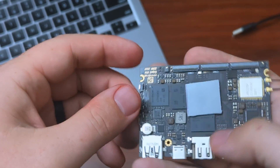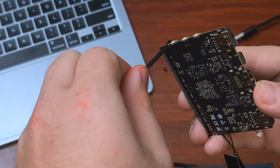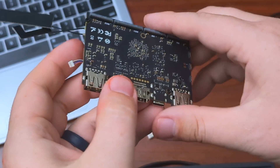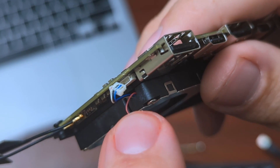It's been a couple of hours and I've been playing around with this thing. The fan installation is pretty easy: get the thermal pad that's included, stick it to the CPU, peel the other end off, put the heat sink and fan in place so the screws line up with the brackets, screw it all down and you're good to go. It looks really good. However, I got these big sausage fingers and by mistake I ripped out some of the wires on the fan header. This is repairable but I don't have the tools, so going forward this is only going to have a heat sink, which is better than nothing.